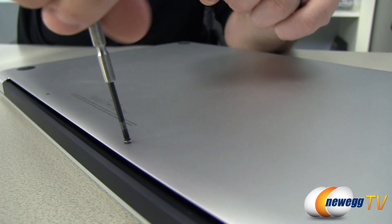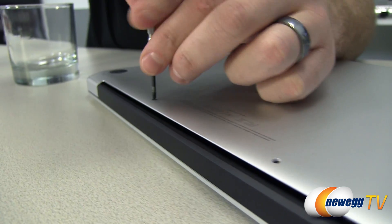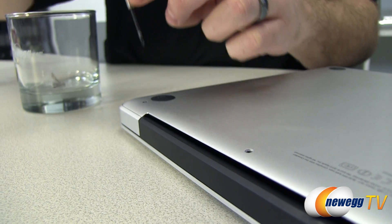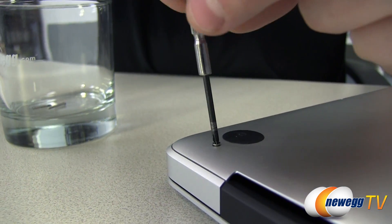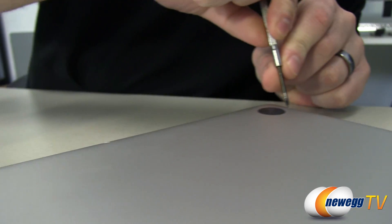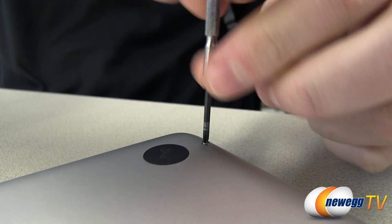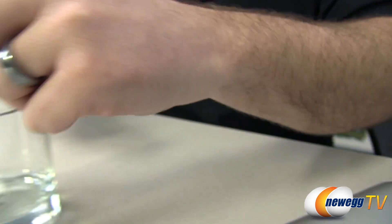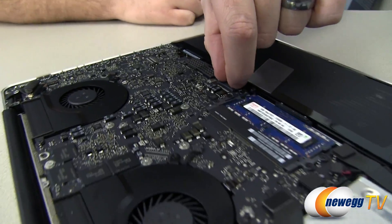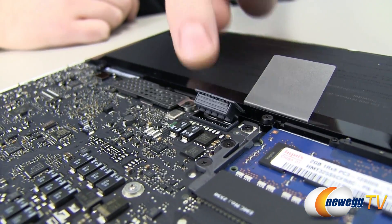At this point it's a good time to remind you that performing this upgrade on your MacBook Pro may or may not affect your warranty. It's a good idea to double-check with Apple to make sure you're within your bounds, or if not you're proceeding at your own risk. That said, we're going to remove the MacBook Pro's backplate — our model has 10 screws, which we'll remove with the Phillips head screwdriver and keep in a safe place. We'll pop off the backplate and then unplug the battery, which is a very important first step to avoid a short circuit.